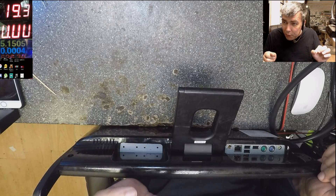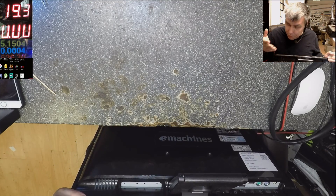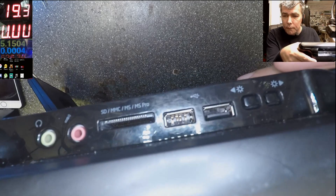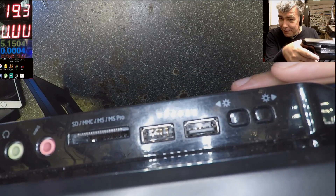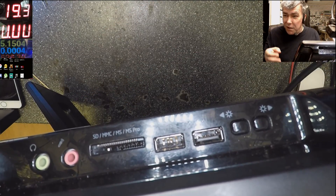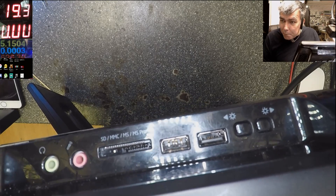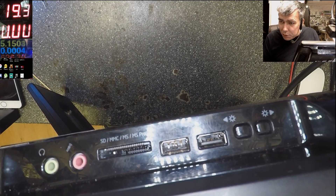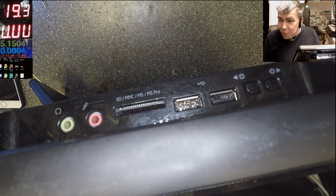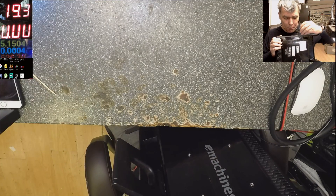The chance of your problem being from a USB port is very high. So if you check - visual check - these USB ports... let's check together. What do you think about the USB? So I took the computer, I checked, I saw the power behavior, and the next step I check the USB ports. And actually this one is broken - the pins, probably the +5V pin, it's touching the ground - you can see there. That's the reason the motherboard is behaving this way.